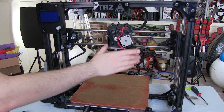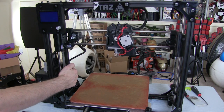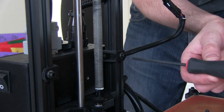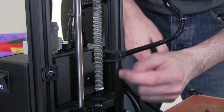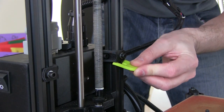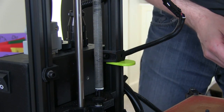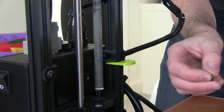I've positioned the printer with the hot end in the middle at a recommended 200mm height so there's space to work. The first thing to do is replace a screw — the guide says this is because the new hot end will hit it as it sticks out quite a bit. A replacement with a smaller head is supplied. I'm using my Lulzbot-supplied hex driver to undo it. It's screwed into a T-nut inside the rail, so they've supplied a handy 3D-printed plastic piece that clips underneath to stop the T-nut falling down while you work.